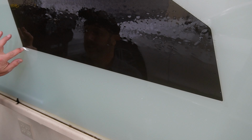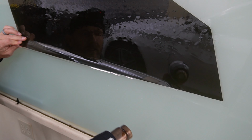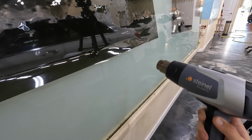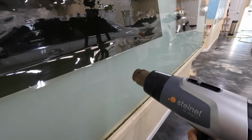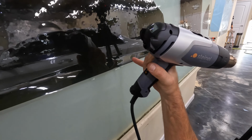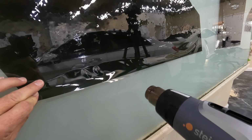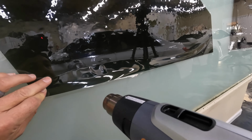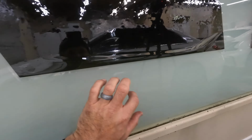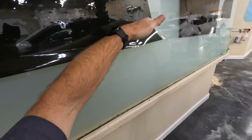I just dropped the heat gun down to 480. Let's try going with a little bit less heat on this. All right, so like I said, the couple inches. That way we can take this a little bit slower instead of moving so quickly. So you can see I'm getting the fingers on the top, but I'm keeping the bottom nice and even, nice and smooth. And then when you let go, and you let the other side pop up, you should notice this crescent moon shape.